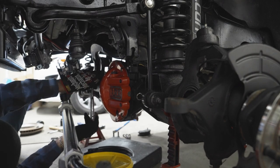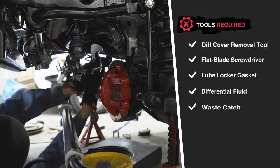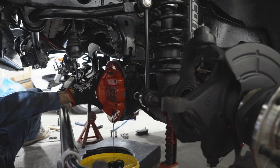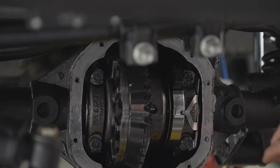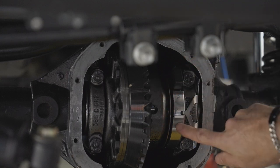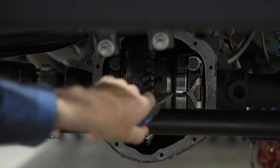It is, however, the only way you'll be able to drive your Jeep home. Here's what you'll need. You have to remove your diff cover to access the locking mechanism. As soon as I removed my cover, I saw that the e-locker plate was in fact in the locked position, and it wasn't moving. If this does happen to you on the trail, just grab a flat blade screwdriver and give it a twist.